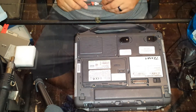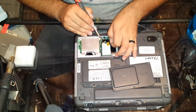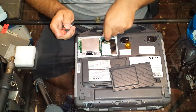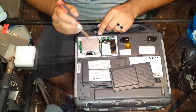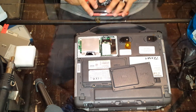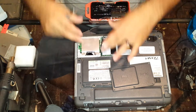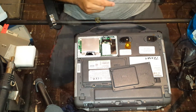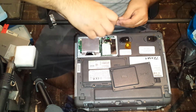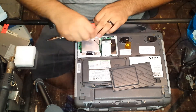Replace your cover. If you're replacing your Wi-Fi card, you have to undo two screws. You have your black wire, which is the main — the Wi-Fi card will tell you main and auxiliary; the gray one is your auxiliary. The cover and plate take a number one Phillips head screwdriver, and a double-zero for the Wi-Fi screws. Remove the two skinny long black screws. This will pop up on its own and then you just slide it out.